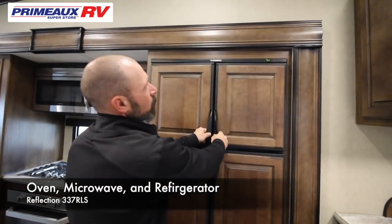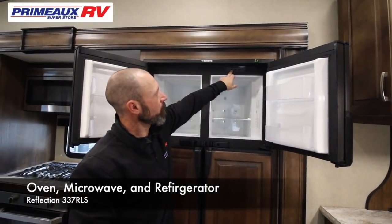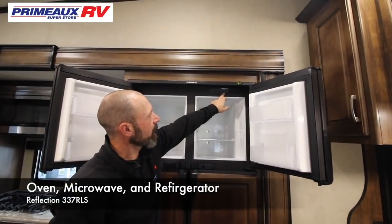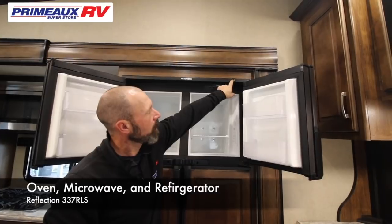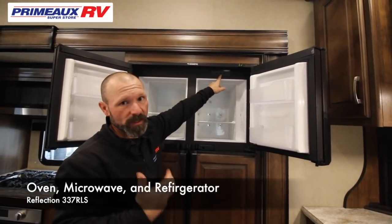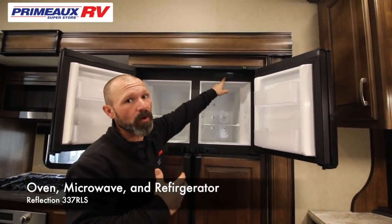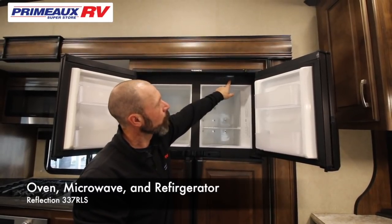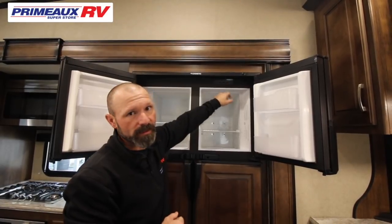Here on the icebox, you're going to open the freezer — that's where your controls are. This is going to be simply your on and off. This is going to be your auto — gas and your temperature. Remember, if you're on auto, keep a bottle on. If the electricity turns off, it will automatically switch to gas for you. And when electricity comes back on, it will switch back to electricity and not burn your propane. The temperature is simply one to five — one being low, five being coldest.